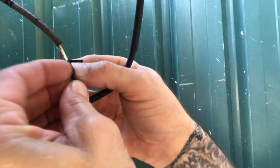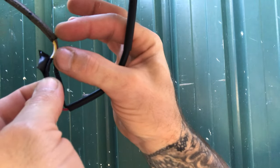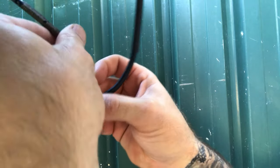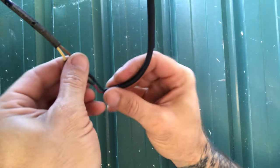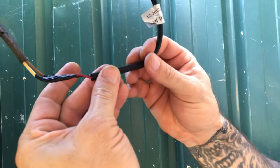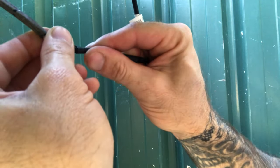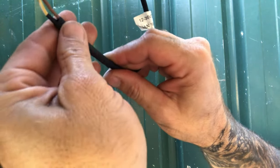Like I said, I prefer to use heat shrink, but if you try to do it this close, the heat shrink heats up being this close to the solder, and if you're neat with your stuff, it doesn't matter. So, two nice, neat joints. And I use some heat shrink I prepared earlier. We'll just wiggle this down. See, a tight fit. That's it.